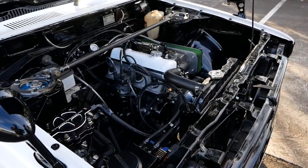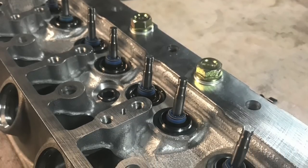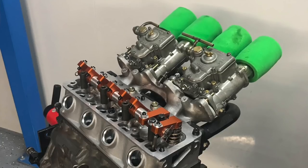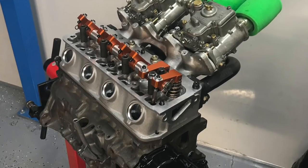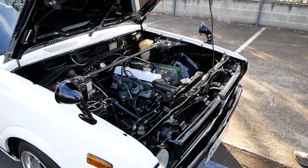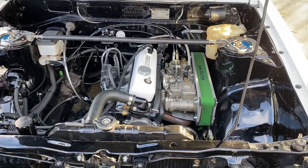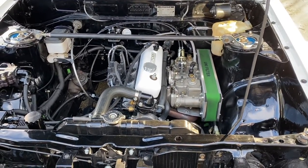The cylinder head is the key to the whole engine. It was a brand new aftermarket replacement cylinder head, but I'd done a huge amount of work on it. It's actually running Nissan TB48 valves, 2J retainers and collets, GDR valve springs, and a Cosworth valve guide. So yeah, it's a bit of a Frankenstein. We put new inserts in the cylinder head so we could fit a bigger valve. Got a custom head gasket because we opened up the chamber quite large, and we've notched the top of the bore so the valve wouldn't be shrouding on the bore. Some big block Chev technology thrown into a 5K.